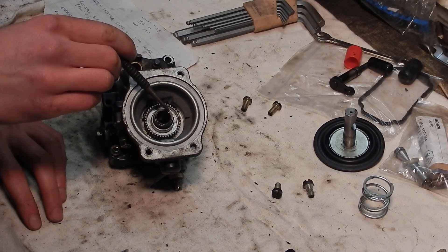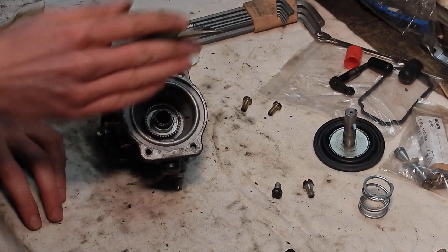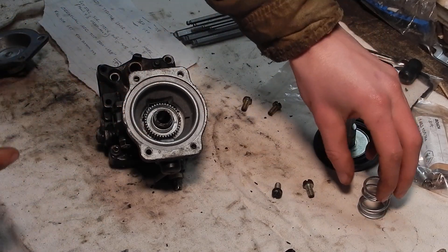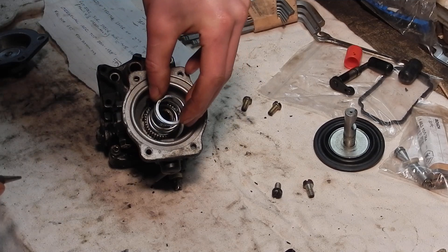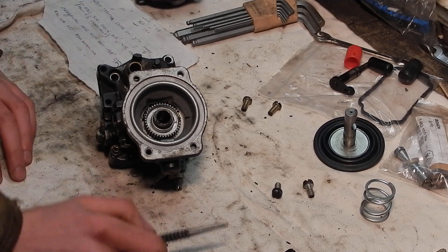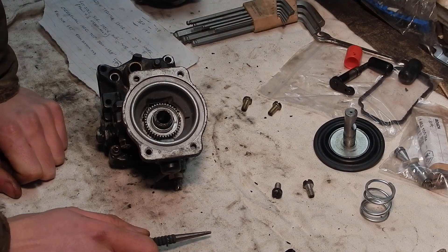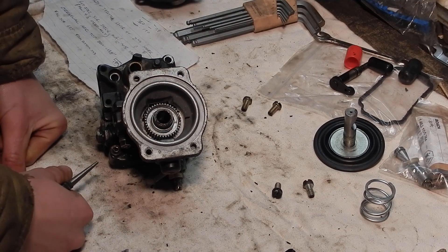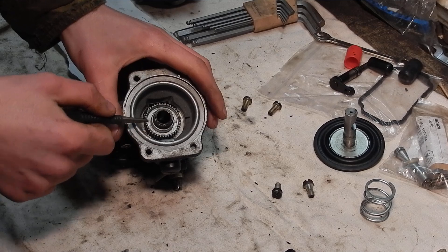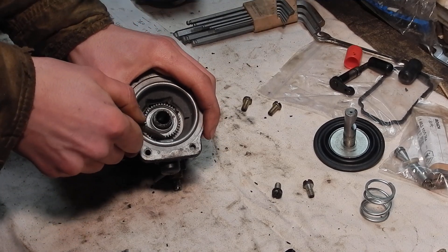I have read and heard of people backing the star wheel all the way up to the top of the threaded piece, and also of people taking it all the way out and flipping it upside down — because with no groove, the spring sits higher and compresses even more. But I'm guessing that's coming from people with twin turbos or a turbo pushing 50–60 pounds of boost, because that's a lot of spring compression.